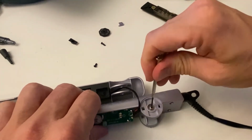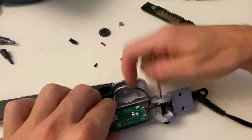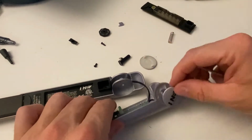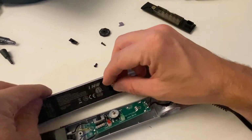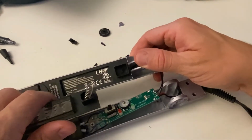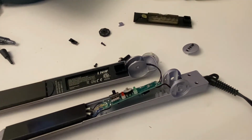There's one screw here that needs to be undone like so, and then this pin comes out, and there's this one, and there are these two cover plates that cover up the hinge from the outside, cover up the screw head. So this is where disassembly starts, and then the spring of course just sits in here like so, just loosely thereabouts. So that's basically all there is to it. It's just going to assemble back together, and yes, hoping for the best at the moment.